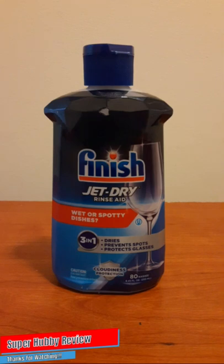Sometimes it can be very disappointing to put your dishes through the full dishwashing cycle and you have wet spots all over your dishes. Sometimes it could be due to a variety of reasons — perhaps the heating element isn't working perfectly — but in my case, after troubleshooting, I felt like rinse aid would most likely take care of the issue we had with semi-wet dishes and silverware once the dishwasher cycle is complete.